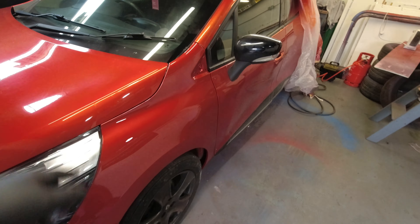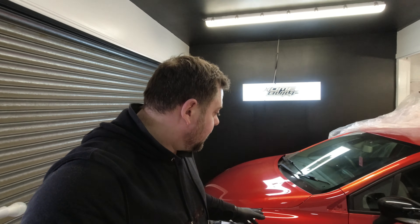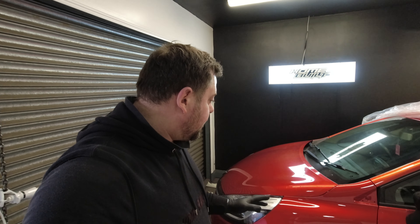So I think we're going to have to get it back and go for a third time, just going with one coat of pearl. The thing is, with this type of job, we don't even know if the body shop that's done it used the right colour of base coat or the right tinted pearl — all I can go off is the colour code. I think we're going to have to paint this again with one coat of pearl instead of two, and blend into the bonnet, the door and the A-pillar as well, which makes it a much bigger and more expensive paint job. But I think it's the only way we're going to get this to match.